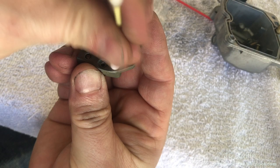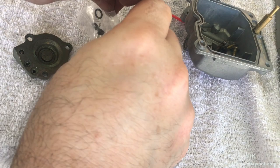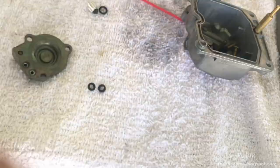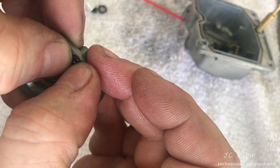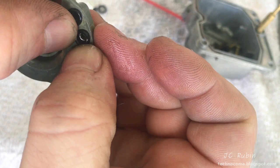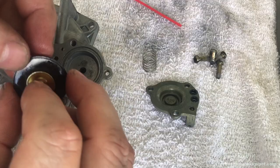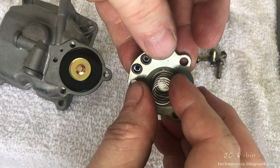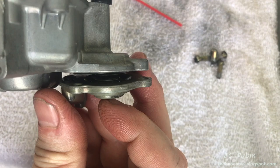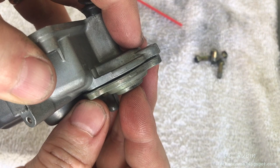The bottom portion is cleaned out with carb cleaner through all the passages and blown out with compressed air. I'll clean and polish the portions where the o-rings will go to make sure all debris is removed and ensure a liquid-tight surface. Removing the two new o-rings from the bag, using a little Rem Oil for lubrication and ensuring the flat side is down, pushing them into the recesses — first one, then the second one. Moving to the bowl cover: lubricating the new diaphragm, which seats perfectly within the notches — a good fit. Spring into position, sandwiching everything perfectly flush.